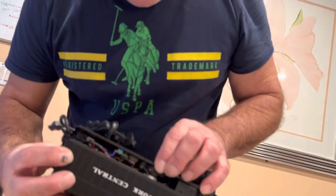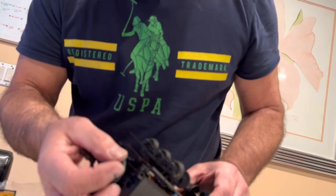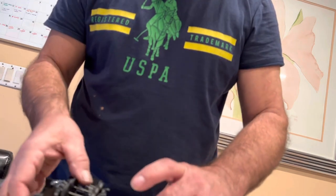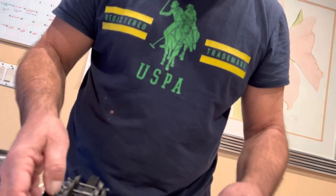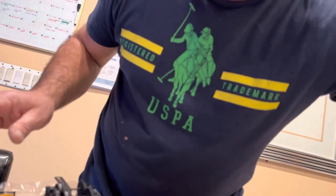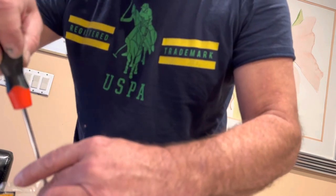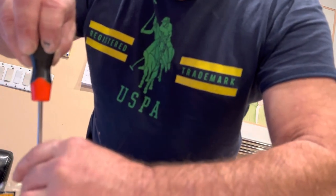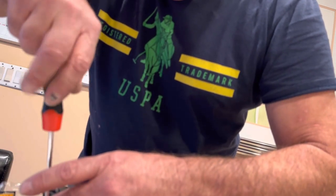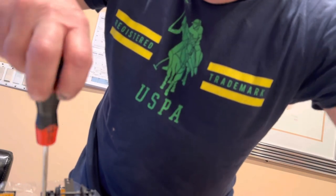You don't even have to unclip the wires. Let me just make sure I'm not pinching any going back into the cover — and I'm not. Make sure this — there's a stopper on the back. They put a little tie wrap on that rear wire. Make sure that stays inside, because if your engine decouples from the coupler, you don't want it to tug on that wire and rip it out of the board.